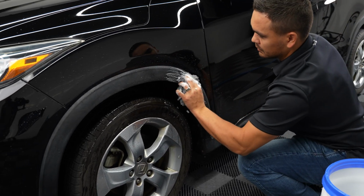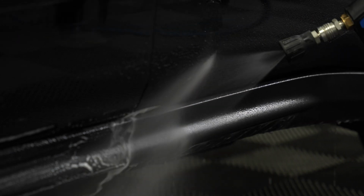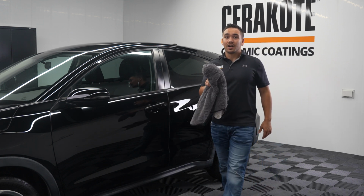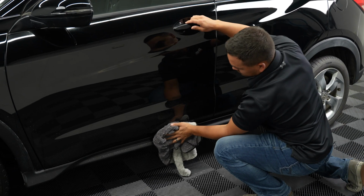The first step is to wash the trim down with a wax-free detergent that will strip the surface down to bare plastic without leaving anything behind. We find that Blue Dawn dish soap actually works perfect for this. After the trim has been washed and rinsed, next step is to thoroughly dry it out because our trim coat does not play well with water.